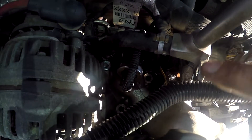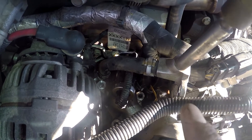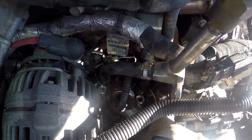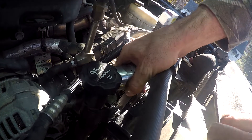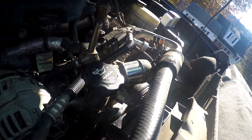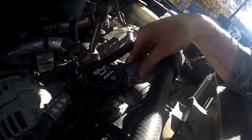Alrighty guys — it may be a little hard to see, but there's one, two, three, and there's one back here you can't see. Got all four bolts out, and you want to take the bolts out — don't leave them in the housing. You'll drop them in the valley and they'll be gone forever. So let's wrestle this thing out of here — it shouldn't be too bad. I'll show you where the thermostats are bad and usually how you can tell. Just give her a pop — you've got to unseat it from the fan shroud; there's a little dowel on there. Make sure your pan is catching most of the coolant. It does typically take just a little bit of finagling to get this out of here.